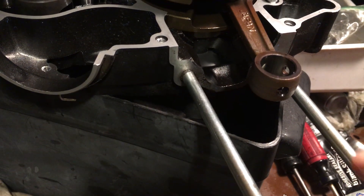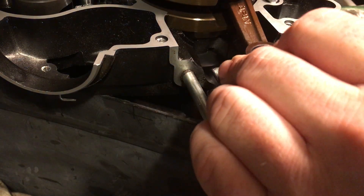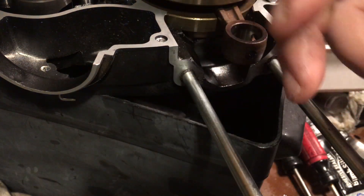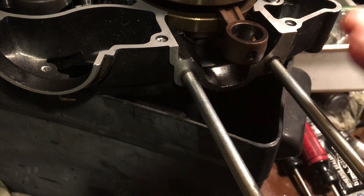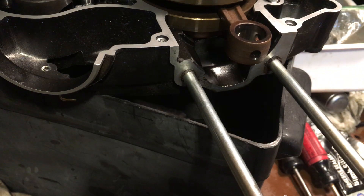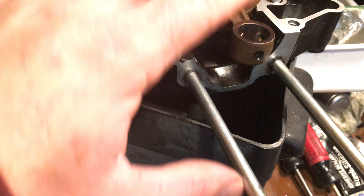The explosion happens and that's the power stroke driving the piston down. It's driving the piston down so fast it's actually pushing more air and fuel up and into the cylinder. That's why a lot of the stuff gets lost out the tailpipe, because this happens extremely fast. So that's my explanation on how the rotary valve works and why these engines are so awesome.